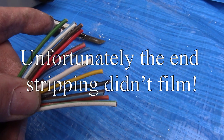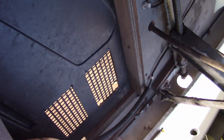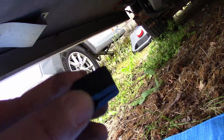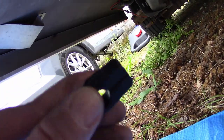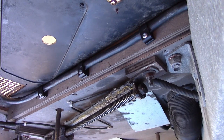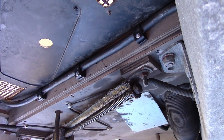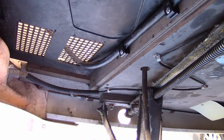All I need to do is just do the ends of the cables for the connector blocks. I've just fed the cable through there and cable clipped it to that wooden fascia. These are the cable clips I'm going to use — the cable runs through and the screw goes through like that, holding the cable very securely. That's all neatly cable clipped to that front fascia under the caravan and it goes up into the locker.